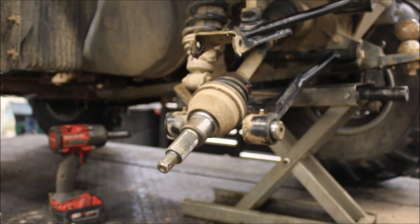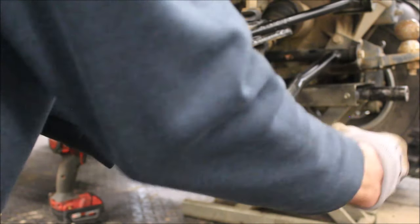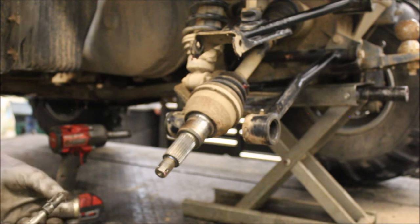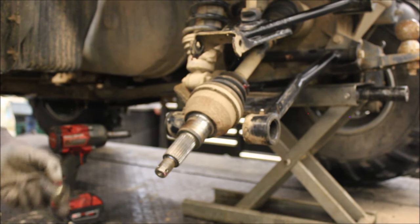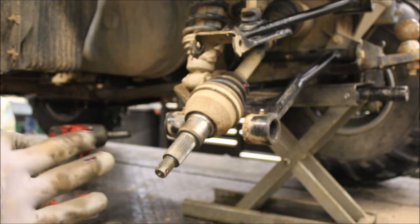All right, so he was correct. It took me about 15 times to... I just want to check these out right away. It took about 15 pumps to grease that wheel bearing. What I like to do before I put this back together is throw a little grease on there and go back together nice and easy.